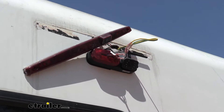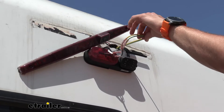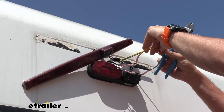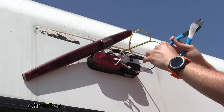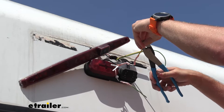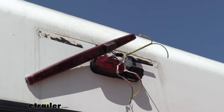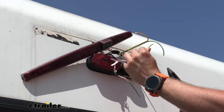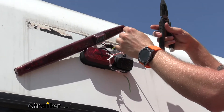Because we're going to need to be placing our filter in between our camera and our actual wiring running into our running light circuit. So what we're going to do right now with the power off, we're going to snip both of these wires. I'm going to pull them apart just a bit. Then from there, we're going to strip back our casing on both sides so that we can splice in our filter.